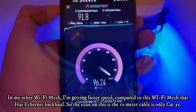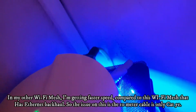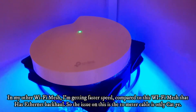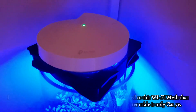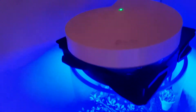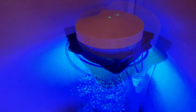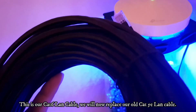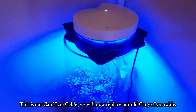My current plan is PLDT Boost 200 Mbps plus Globe, so it should be around 200 Mbps or more. So what's the issue? The issue is the cable. As you can see, the internet cable connected to this Wi-Fi mesh is Cat5e and it's too long. Cat5e can't handle more than 100 Mbps over longer distances. So what we'll do is replace this cable with Cat6.